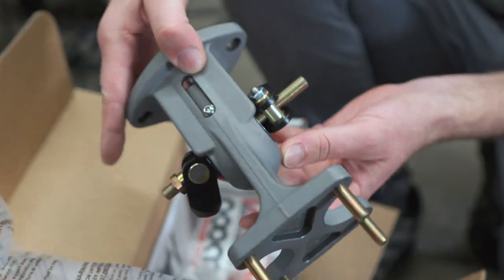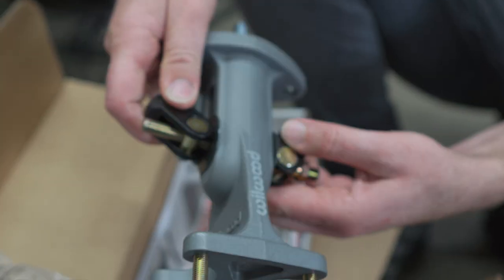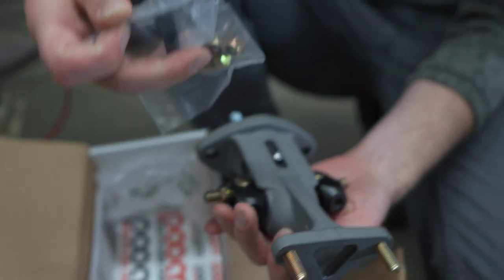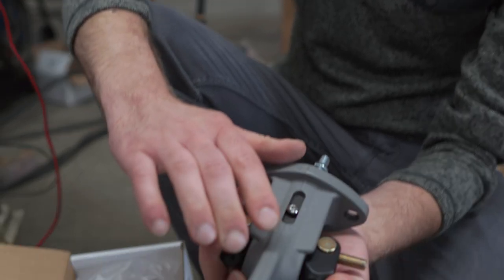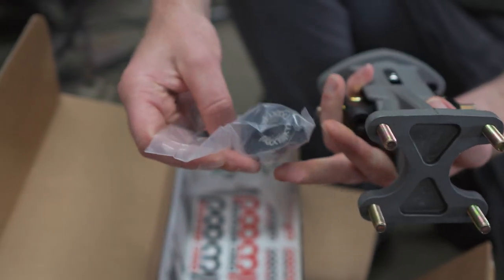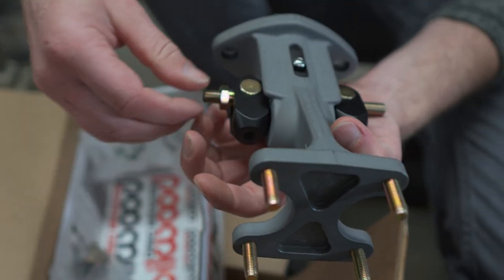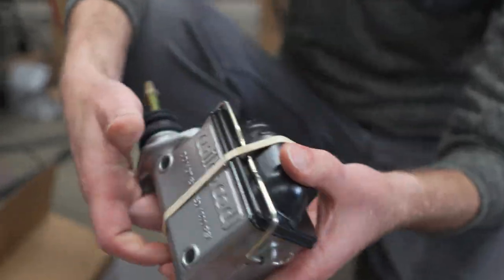Here we've got this really cool cast custom-made piece by Wilwood in Arizona. This would basically be the replacement for a proportioning valve, so that you don't have to proportion your brakes via a hydraulic valve. What's also cool is there's a knob you can install on the side to adjust your bias, or you can have a remote adjustment with a cable inside your car to also adjust the bias on the dash.